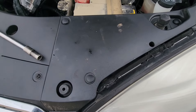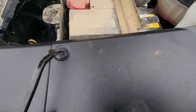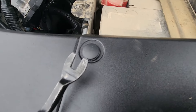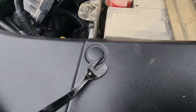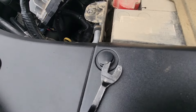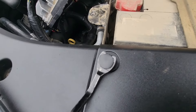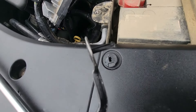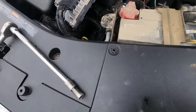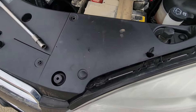What you want to do next is remove three plastic trim screws — this one here, this one here, and the one right here. To do that, take the middle piece and pry it out. This middle plastic piece is supposed to come out just like that, and then you can completely remove the plastic piece as well. Do the same on the other two.